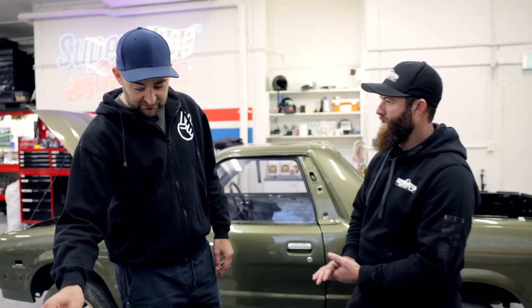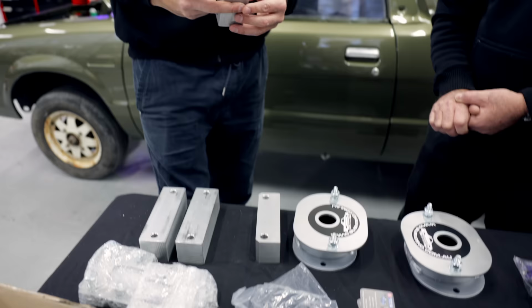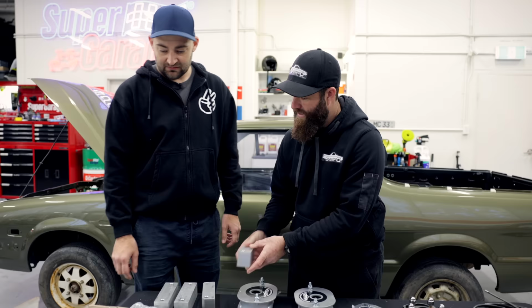And so this means basically we've got to lift the subframes and the body away from each other. Is that what the blocks do? Because that actually looks a lot like, I don't know if you guys remember, but when we did our Outback and a few other cars, factory they look like this. Just not as big. So basically we're putting blocks between the running gear, spaces between the suspension, front and back, and the extended bolts and hardware that's required.